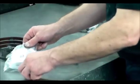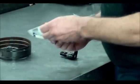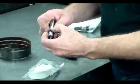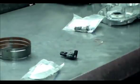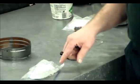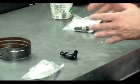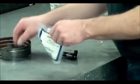Here are the Teflon rings. When installing this pin, put the Teflon seals on it with a lot of grease — I like to use the thicker green trans gel. First fit the seals onto the pin and put the pin into the case to make sure the seals are not going to get caught and get torn. It is a pretty tight fit with no chamfer, so you want to be very careful with that.